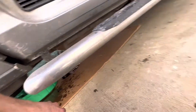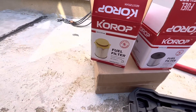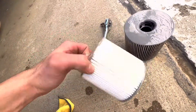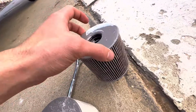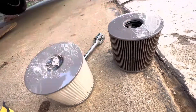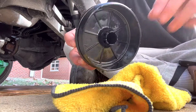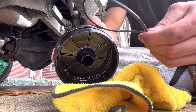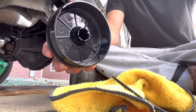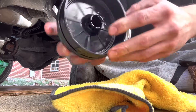This is going to be your fuel filter for underneath the truck, and this one is for the engine bay — this is your water separator. There's definitely a big difference in color. This is the brand new one and this is only about a month old, but I drive my truck a lot, so I try to keep these changed every two oil changes or so. The new filters do come with a seal or O-ring, so you do have to replace the old one and put the new one in.